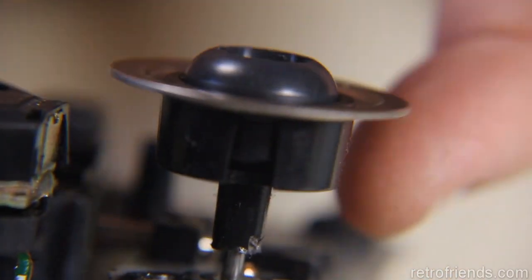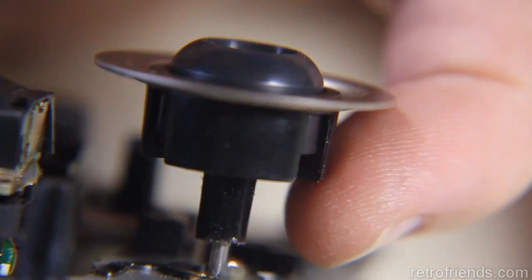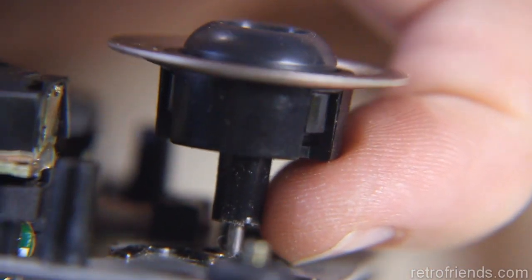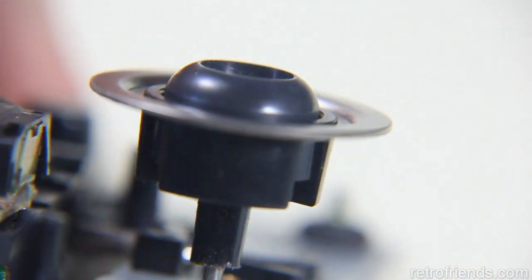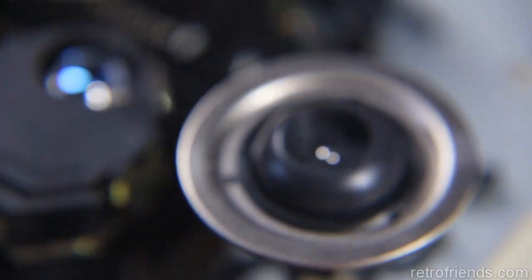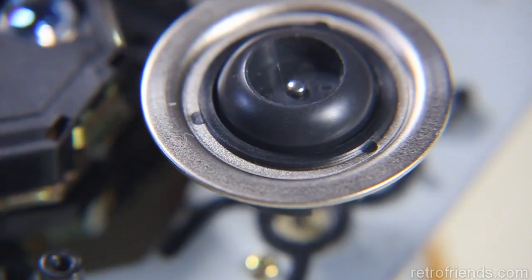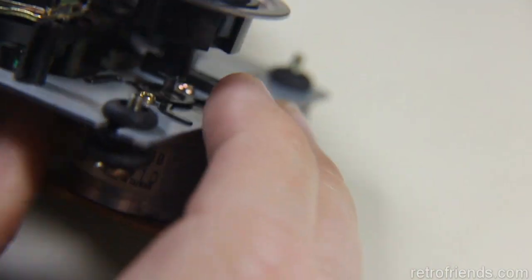It's contact with the shaft of the spindle here connects with the motor shaft, and it's like 3/4 of an inch long or something like that. So that's quite a long contact. That's kind of why it sticks. It's not glued on there, you know. So anyway, I've pushed it up too far, really, which is going to happen, obviously. And so the next thing I want to do is get it flush.